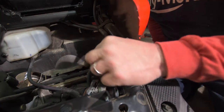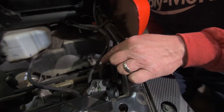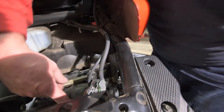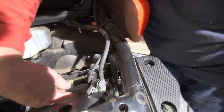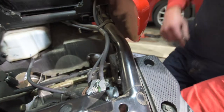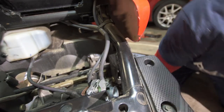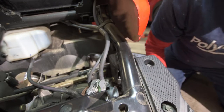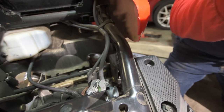What I'm going to do is pinch off the fuel line and then take the fuel line off. I believe it's just a little clamp right there, and then I should be able to take the carb off, turn it upside down, and get the jet out.